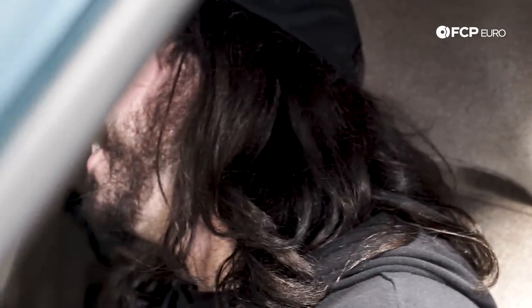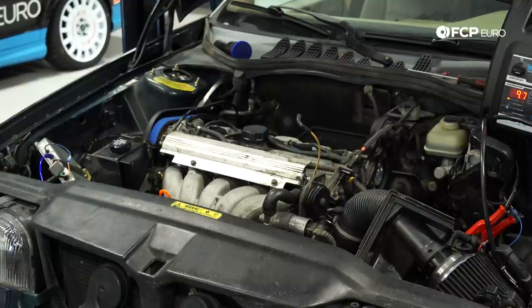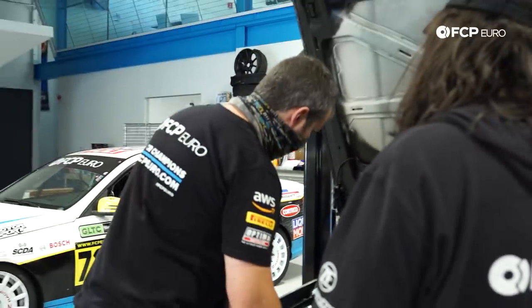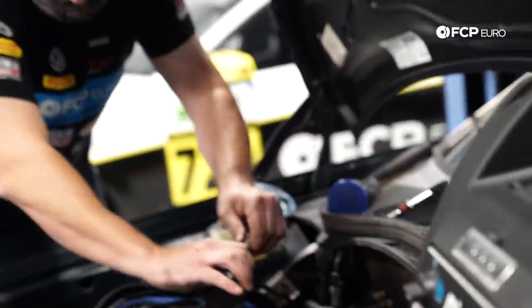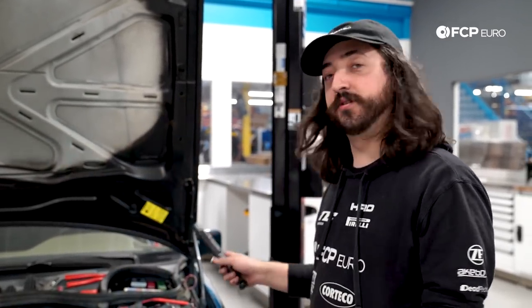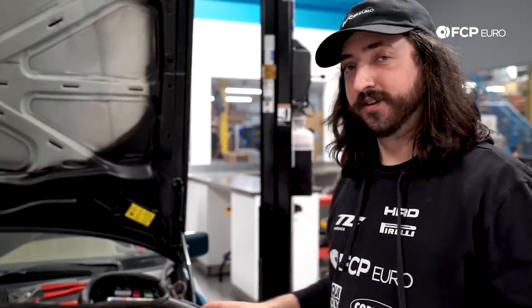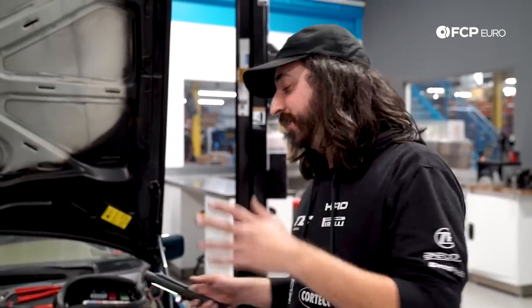My heart is beating fast — I want it to start, but at the same time I almost don't want it to. It's just scary. All right, here it goes. Fuel pump's kicking on. It has fuel because I hear the fuel pump running, we know it has compression, so the question is spark, or whether there's just no power at the computer. We got spark! I was just on the phone with Aaron from Vast Tuning — he was super helpful, troubleshooting and walking through on the phone. We had confusion because there are so many different wire harnesses and variations from different years, different diagrams — this is a 1997 850 naturally aspirated automatic engine harness in a 1995 850 body harness with an M4.4 ECU. There's a lot going on.